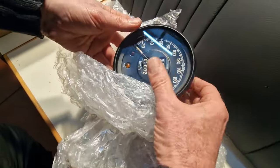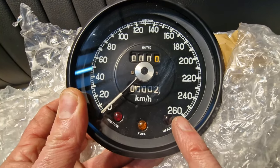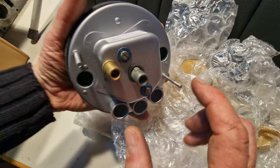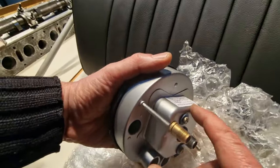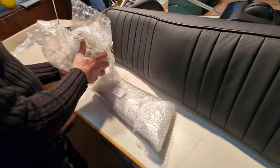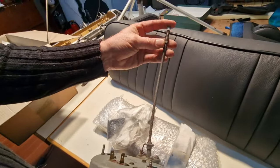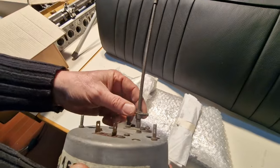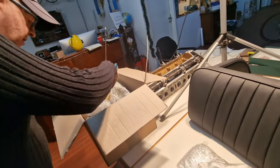We got the instruments done. For Germany we need the speedometer to read 260 kilometers per hour, so this has all been done and converted to the correct ratio. We will change the differential ratio from the 3.31 to a 3.07 — a lower ratio for more silent running. Make sure you have the instruments done and make sure you have all the bits there. This is the original rev counter — make sure it is all tested and that you have the clock setter, as sometimes they go missing. The rev counter will be polished again and then we are ready.